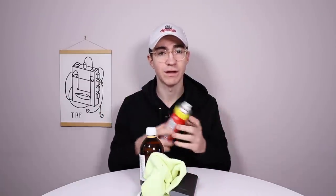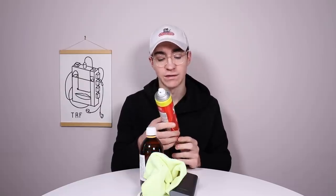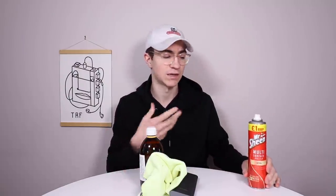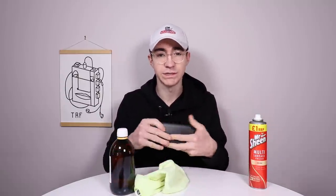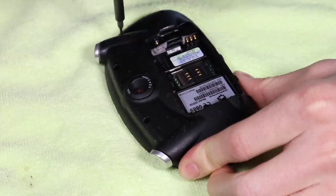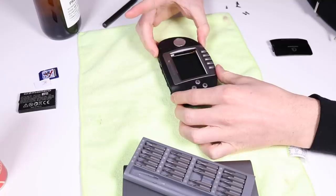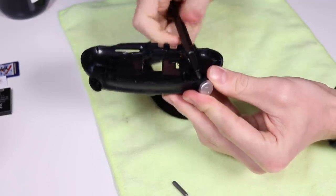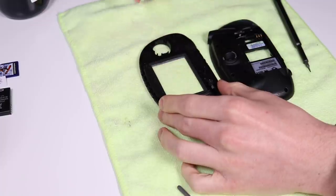There are a few things you're going to need — hopefully you'll have most of them lying around. This is Mr. Sheen, just a multi-surface polish. In America you can get something called Pledge which does the same thing. If you can't get this, it's not that important — you can just use water on a rag, but it leaves things smelling nice and polishes the plastic. You're also going to need some tools because you'll want to take the device apart first, since isopropyl alcohol can get into crevices and components. It evaporates almost immediately, but you might not want it getting down into the rubber membranes underneath, as there's a chance of weakening their structural integrity.